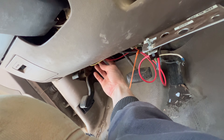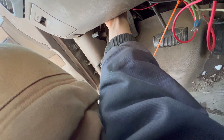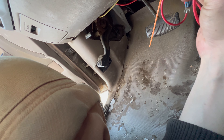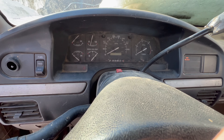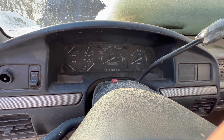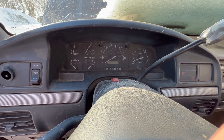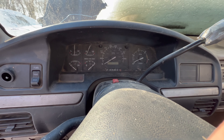We've got an issue somewhere here. The switch could be bad. Oh yeah, it looks like it could be very possible right there — it's loose. Let me tighten it up and we'll see. Okay, I tried to tighten it down — it turns on, but somebody said to crank it with the glow plugs on so we'll try that. Glow plugs still aren't working, because it should fire when the glow plugs are on.